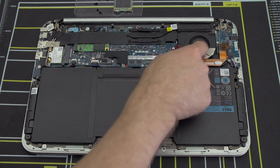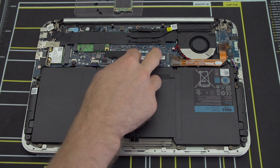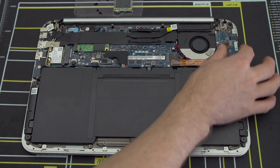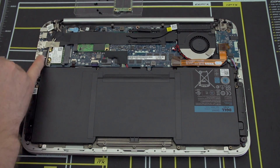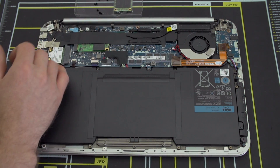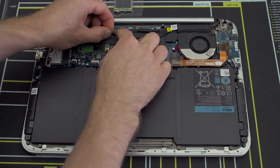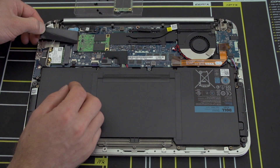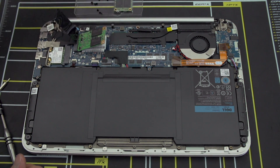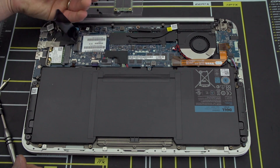You can see the cooling fan for the CPU right here. This uses onboard graphics. Here's the main motherboard where you've got your RAM soldered on — four gigs of RAM by default, though the fourth-gen model comes with eight. There's a little daughter board over here with some I/O. Right here is your wireless, which you can see is plugged into the antennas. And here is our mSATA drive that we're going to be replacing. All we've got to do is peel up this little cover, and we see it's held in by one simple screw. Once you remove the screw, the mSATA drive actually lifts itself — this is a function of the slot and it's supposed to do that, which makes it very easy to carefully remove.